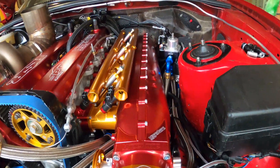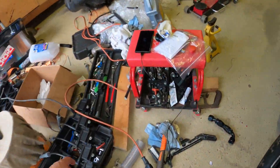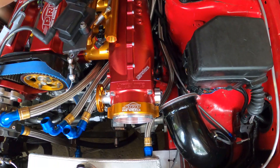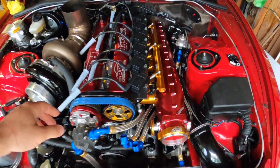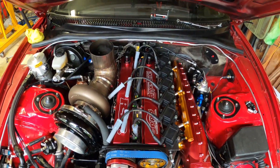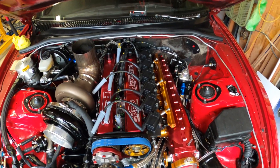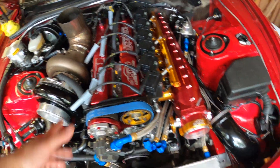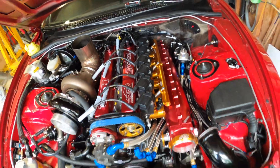It's coming along — sorry about the mess. I'm thinking I'll put the coils here, not sure yet, but putting them right there makes it easier to service. We check the plugs all the time, so you just pull the cable, pull up the fire core, and you can check the plugs. This way the coils are not sitting on the heat either.